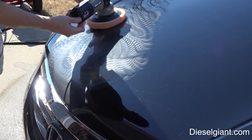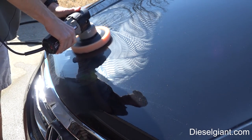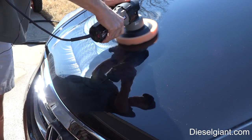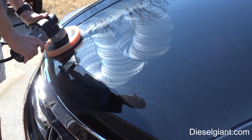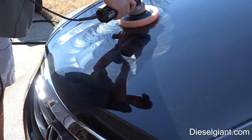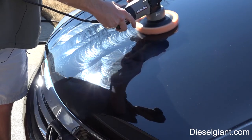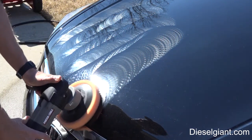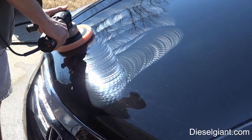Then I'm going to turn it up to about speed five. All I'm going to be doing is going back and forth, overlapping about 50 percent. You can see the polish — it looks kind of like a hologram — and then I'll go the opposite way and turn it up a little faster. This kind of polishing won't hurt the car because it's an oscillating random orbital; if you press too hard the pad stops, unlike a forced rotation like body shops use. People ask how you know when to stop — when the polish starts breaking down and turns to dust, that's when we stop.